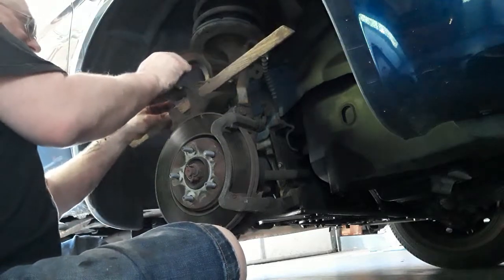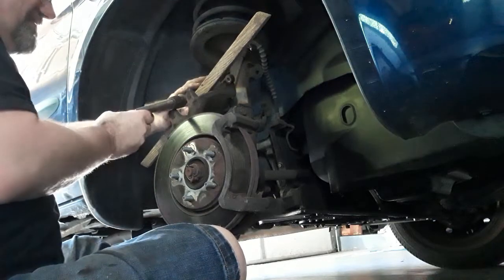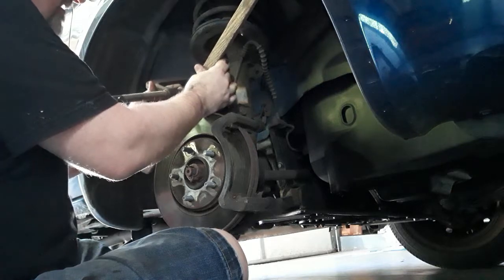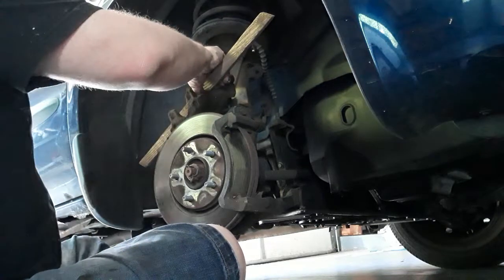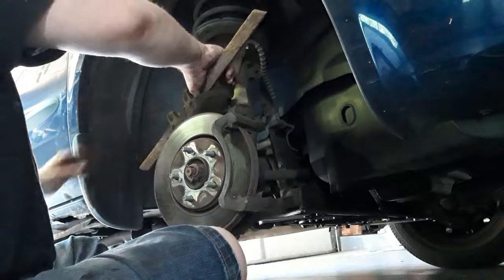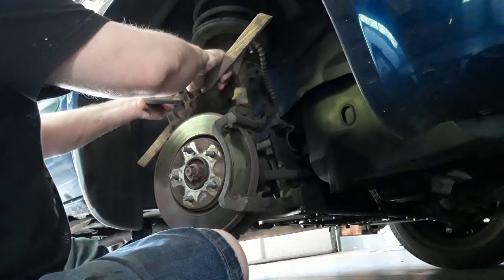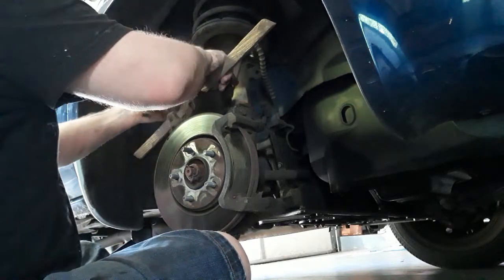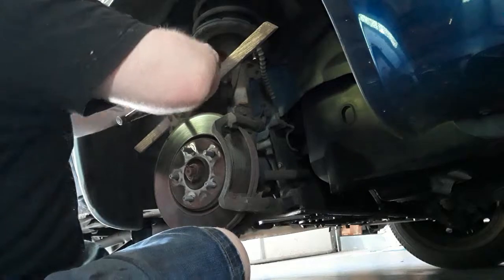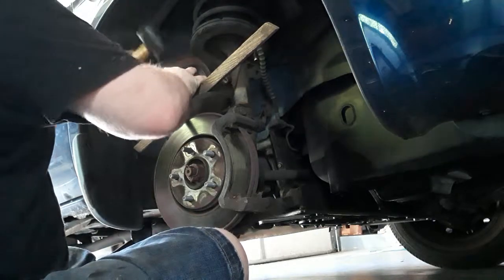You always do your brakes as a pair. If you can't afford to do all of your brakes, get the front ones — unless your back ones are literally smoking — because the front brakes handle about 75% of the stopping. Let's see if I can compress some of this by hand. I'm more likely to snap the board from the feel of it, so this is where the rubber mallet is probably going to come in very handy.